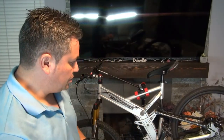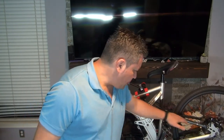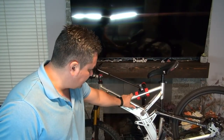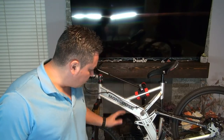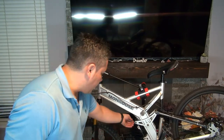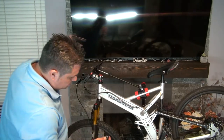Alright, so I got the rear brake routed — kind of zip-tied over here on the link on the back. It's a bit ghetto but I don't want to mess with bleeding these things right now. Everything is mocked up. The spacers worked out like a charm. I'm gonna see how much air is in the shock and add more as needed, since it doesn't have a rubber band or anything to set the sag. I'll inflate it and put the same pressure on top and bottom.